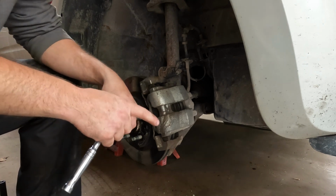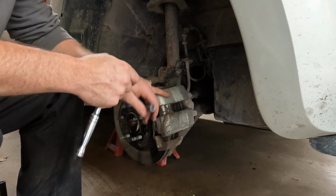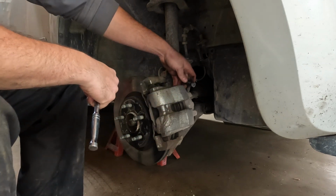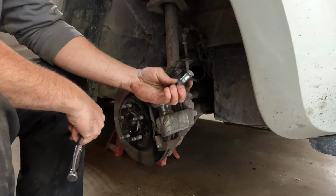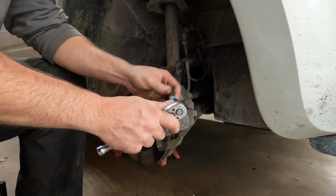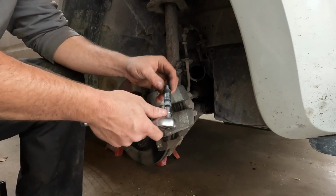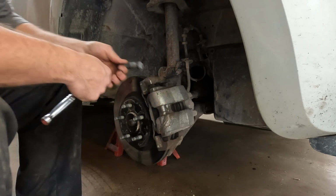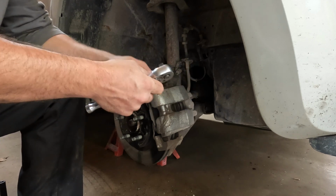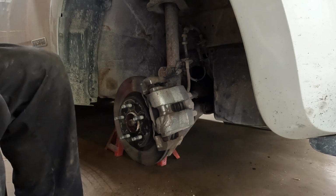Okay, I turned the camera back on a little bit earlier than I said I was going to. There's a couple reasons for it. Things I forgot were a thing with this. One is that the bolts that hold the calipers on, the slide pins or whatever, are a 9mm Allen wrench. That's not a typical size you're likely to have in your set. So if you're planning on taking this stuff apart, you might want to make sure you have one, or go buy one first. That seems like a giant pain. Kinda.